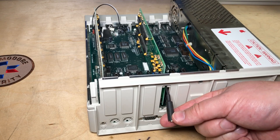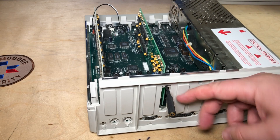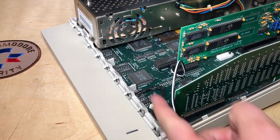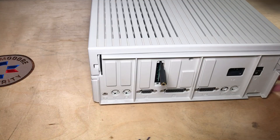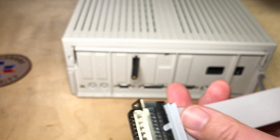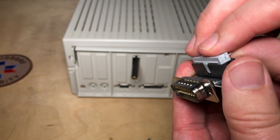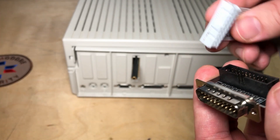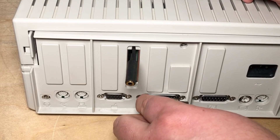Now I'll put that card in. It's ugly, but I'm just going to use this little extender here that I got with my smartphone battery case. So is there an official way of making that prettier? I don't know. To close it up there's just this kind of lip along here, and we'll just close it up. While we're back here, just hook up a couple of the other things. The Floppy Emu has this connector on the end — it's got this ribbon cable. So this is the internal Apple connector and this is the external, and this actually just converts between them. Here's a floppy disk connector — we'll just put that on there.